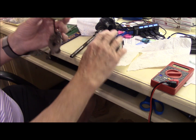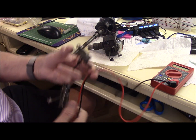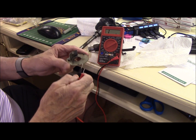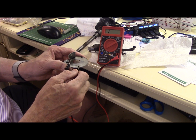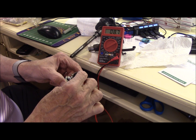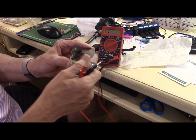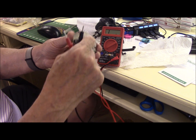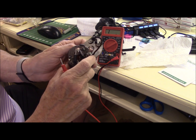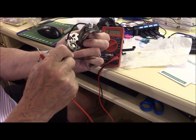This is the lower plate that's attached to the base of the distributor, so that's all grounded. This other piece isn't grounded. Now, if you have a simple ohmmeter or continuity tester, you can touch that piece and this piece — there's no electrical communication between those two. If I touch that and touch this part, now I have continuity between the two probes. So it's connected to the passenger side of the coil. Then it goes through to our famous little black wire, and that can't touch anything — that is so you can adjust your spark.